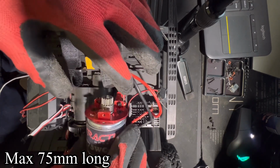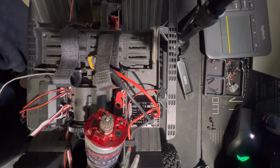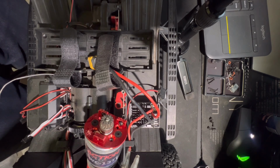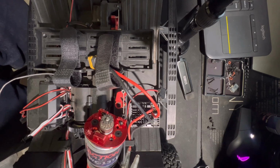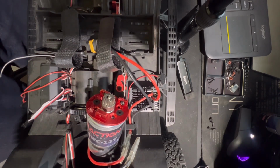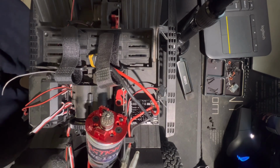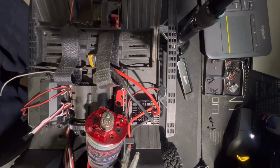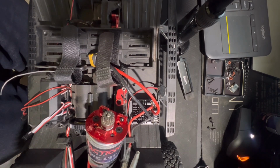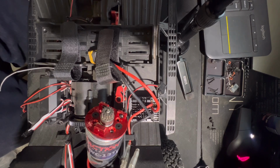So I'm just going to set this motor down over here, and I'm quickly going to measure the motor that I've currently got and that we're going to put into test and see if that'll work. If that doesn't, then we'll put this back. The one thing that I don't want is cogging, but I'm also going to set the settings on that motor in such a way that there's not so much power initially, because these are BFG KO2 replicas, and I really like BFG KO2s. I've had them on many of my vehicles, and some people complain about them, some people don't like them. For me personally, they've worked really well, so I don't want to run them down. When you put a brushless motor in, chances are we'll be doing a lot of dig outs, and these nice beautiful tires might get messed up, so I don't want that to happen. So let's go measure that other motor, and then I'll be right back.